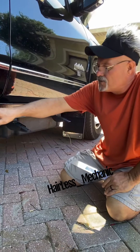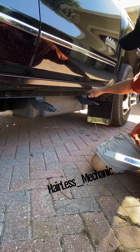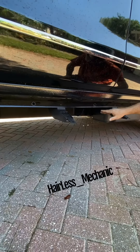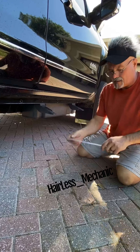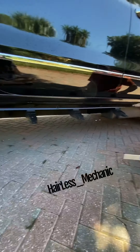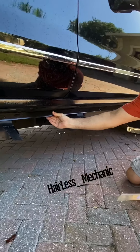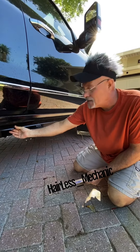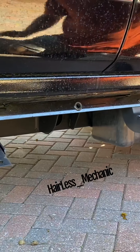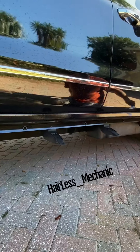How I've attached this is I've used quarter-20 bolts. However, these two particular brackets behind your ugly tank actually have steel behind them. I didn't find steel behind the other two or the four on the other side. This bar here I got from Home Depot. I measured it to the rough length of my Nerf bar and then split that in half, because these are three-quarter inch lights that go in here — you can find them on Amazon. I used a step bit and drilled in three-quarter inch. Then I figured out where I wanted this end to go, found the center point between that, and that's how I had mine centered up.